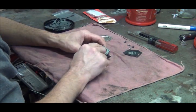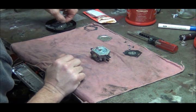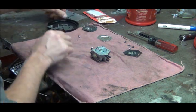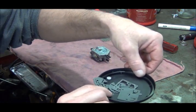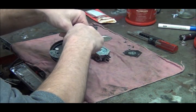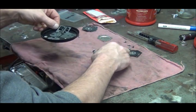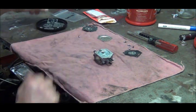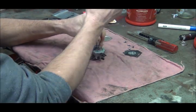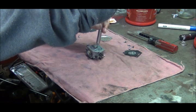We need to take this plate off — there's a needle and seat in there. Here's the needle, with a little clip. There's also a little filter screen which goes underneath the other plate on the other side of the carburetor. This little plate here requires the exact fitting screwdriver — it was kind of hard to find a bit that fit it. Luckily I had some bits for this little ratcheting screwdriver. These screws are easy to strip out.